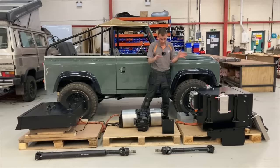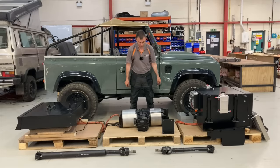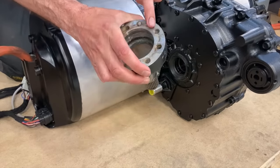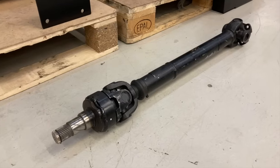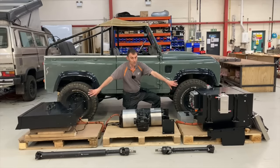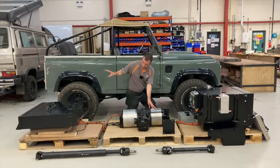We need to get the Tesla power to the wheels in this four-wheel-drive vehicle. The Tesla drive unit actually has a limited-slip diff built in. We've got custom adapter cups — Tesla spline on one side and Land Rover bolt pattern on the other — so it bolts straight into a Land Rover prop shaft. The front prop is a standard stock length, but the rear is lengthened by around this much. We always recommend partners upgrade the axles given the torque involved, and to add limited-slip diffs in the axles as well.